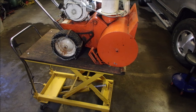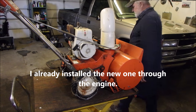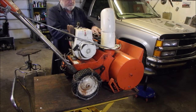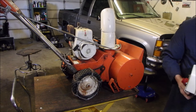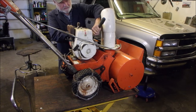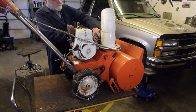Electric start is now mounted again. So yeah, I'm going to start working on that fuel line. Just have a nicer view. So I need to shorten that fuel line a tad. I don't want to take the chute off to get more room, but I might have to. I got to measure what I need. So here I need just that much. So if I go into the hole here, hopefully the stud from the shutoff valve doesn't hit. Well, I can take off a good eighth of an inch there. And that's all I'm going to need. I took more.